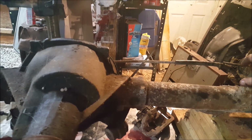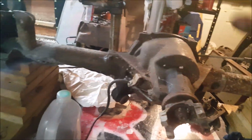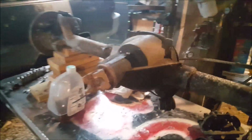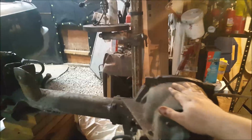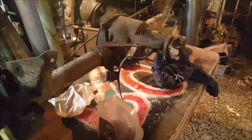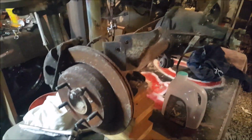Working on the rear end for Christine here. This is my Posi 9C1 cop car rear end, out of a 95 Caprice. Most of them are stock with disc brakes if they're the actual cop car. Now if it has the 4.3 LT, the baby LT, it'll have what this has, 323 gears in it. I really wanted the 308, but 323, hey, Posi's a Posi.